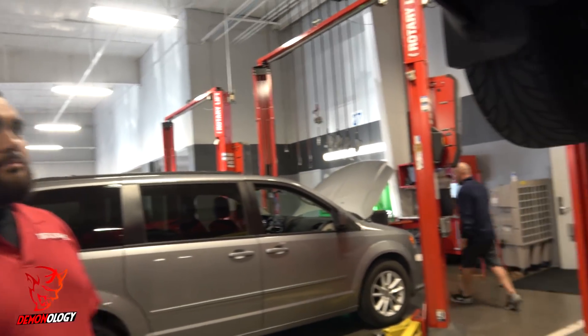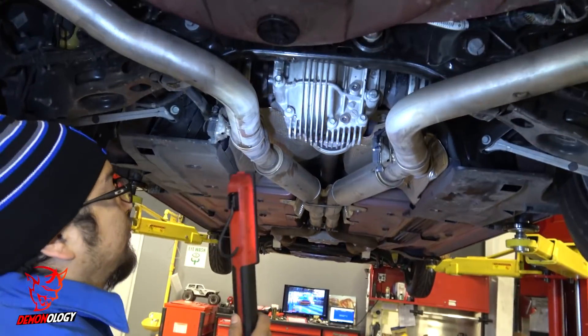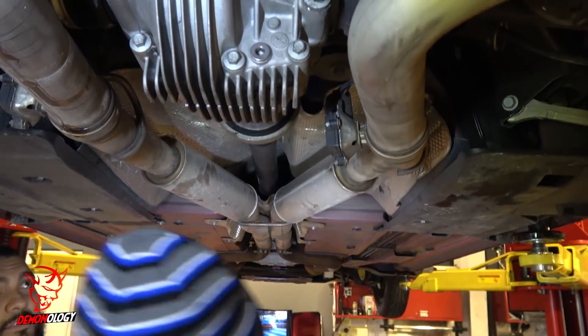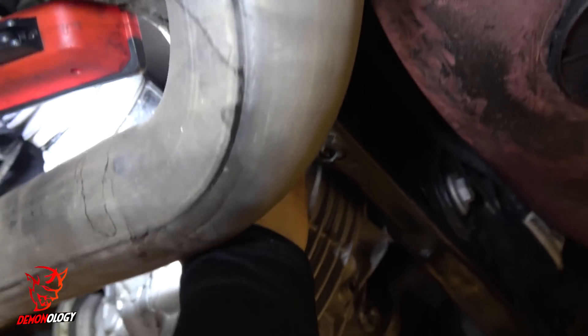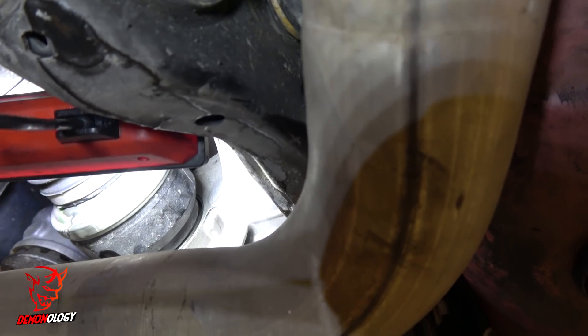What was the case with your injectors? You get your new injectors in? I just sent them off to get cleaned, put them back in, and it fired right up. Well, my car was knocking the last time I was at the drag strip, so I brought it in for Luis. He found that the bearing in the drive shaft has gone out in the middle — the center support on the drive shaft. If you push it and look from here, you can see it's gone. That's way too much. Looks like there's a little fracture in the differential.